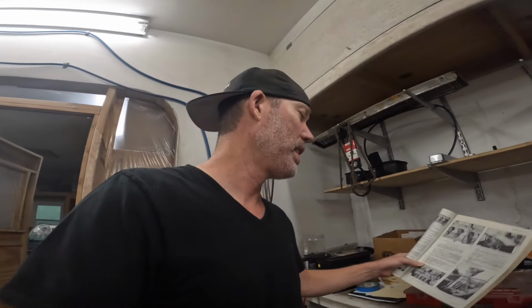All right, guys, it's the next day, and thanks to some YouTube, I have some revitalized confidence here. I think what's happening is the rockers, and it seems like they make noise when they're too loose. So that's a good thing, because we can fix that. What I'm gonna do is pull the valve covers off and try to reset it like I saw on the Rookie Engine Wrench channel.